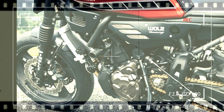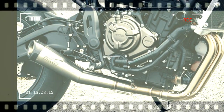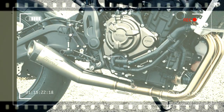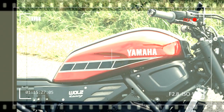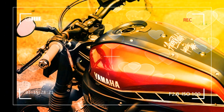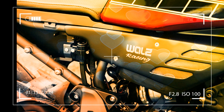What are the technical and design specifications? Here are the important modifications and parts: Rotobox carbon wheels, one of a kind. Complete bodywork, except the gas tank, is handmade from 2mm aluminum. Suspension front and rear is from Wilbers, both one of a kind. Exhaust is made by SC Project in Milan. 520 MotoGP racing chain with matching front and rear sprocket. Rear sets from LSL. Many Wallswerk parts like handlebar, brake and clutch levers, both preload adjusters, gas cap, seat, etc.